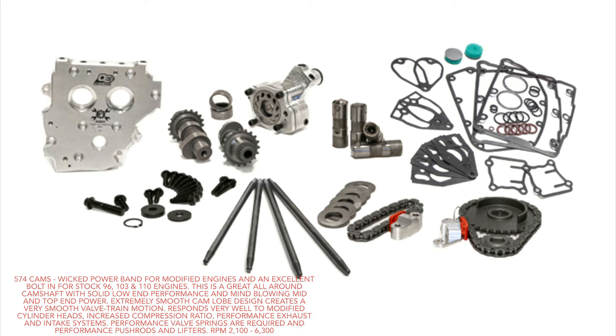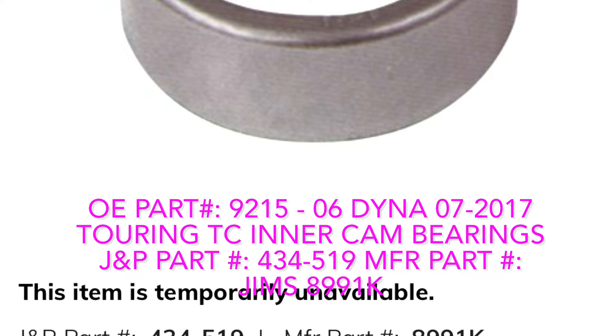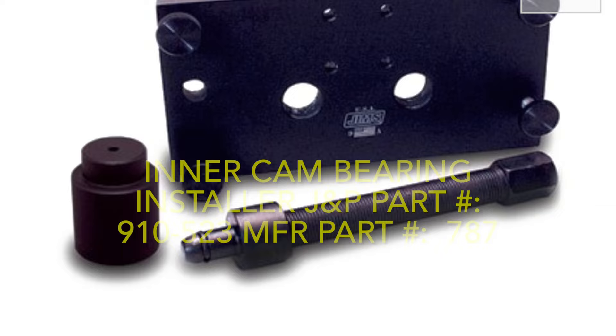Please remember: any time you replace a cam, always swap the intercam bearings — even as a safety measure. You absolutely don't want one of these little rollers to seize up and then seize your entire cam chest. Jim's has additional rollers and OEM equivalents. Fueling cam install kits include these along with the necessary gaskets and new ARP hardware.